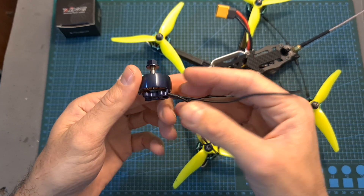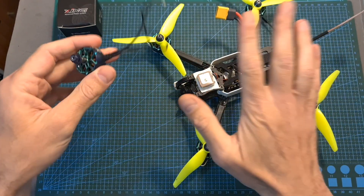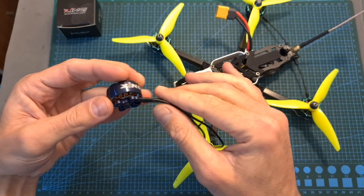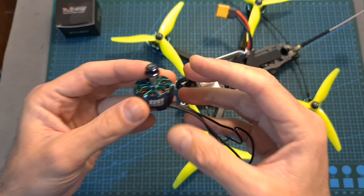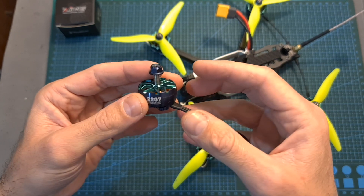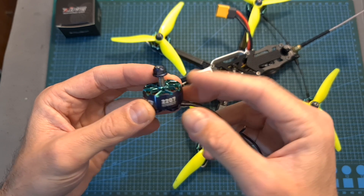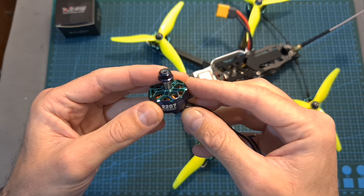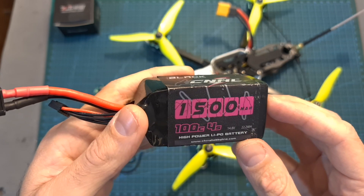After this quick introduction, I'm going to show you the thrust test and the flight footage. In my experience after testing these motors, I think they are very smooth. However, I think that at least for me 2755 kV is a little bit too high, so personally I would go with the 1855 kV motors and use them with 5S and 6S batteries. In addition, these motors are battery killers — you can see in the thrust test that if we compare them to similar 2207 motors, these are more demanding motors, so my batteries just couldn't handle them well.